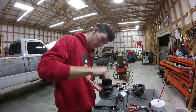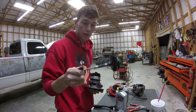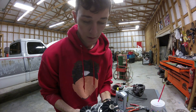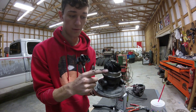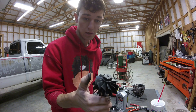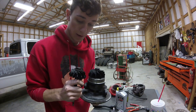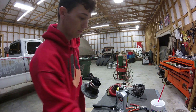It just fell in as soon as I was getting confused. Very free spinning. The stock turbine wheel and shaft won't go back in - it's probably bent, so that needs to be replaced anyway. For a size comparison: this is a 76, measured at the bottom of the fins, 76/67 turbine wheel. This is a 70 compared to the 76, and a 60 up top - so a 70/60 stock turbine wheel versus the 76/67. This one has 10 blades, this has 12 blades - it does make a lot of difference.